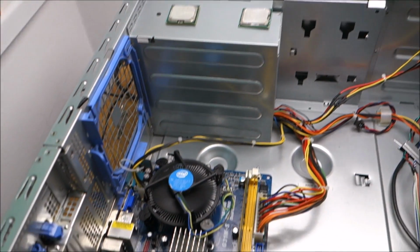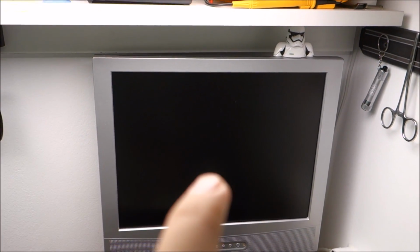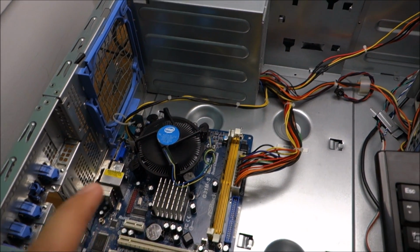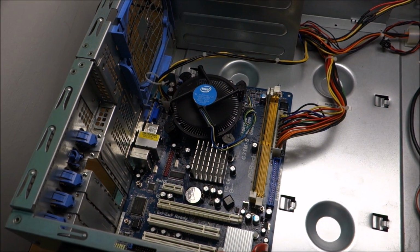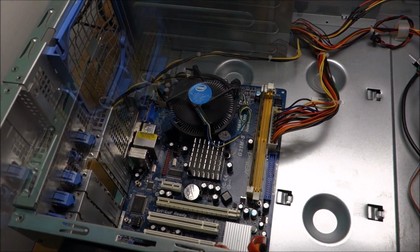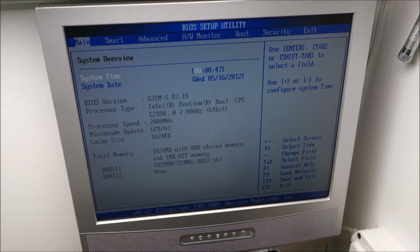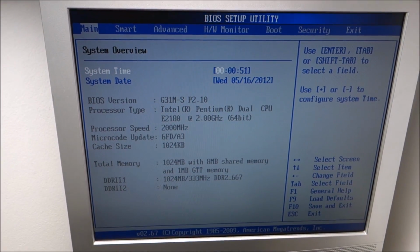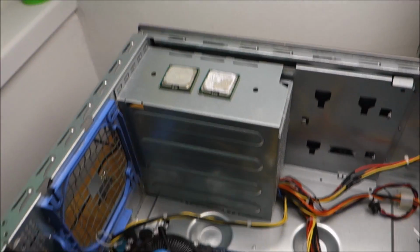just a blank screen, no beeping, no anything. Just once I saw the BIOS logo, and a second time it went beeping continuously with the CPU. But yeah, I think the problem are the microcodes. So let's update those. Original Pentium in, no problems running. I have the latest BIOS version, so that's not a problem. I just need to add microcodes for Xeons.